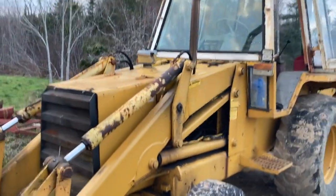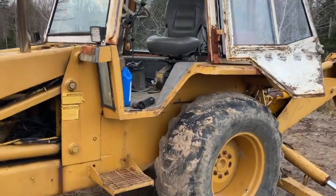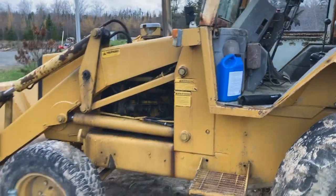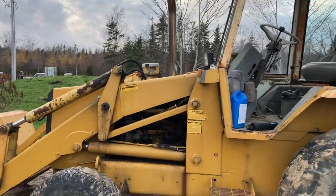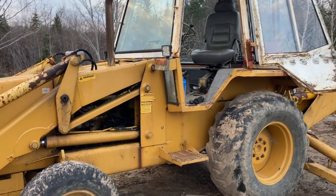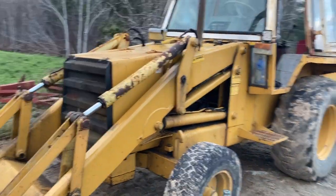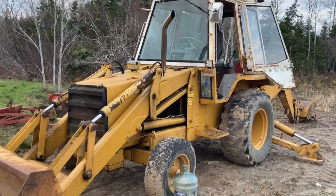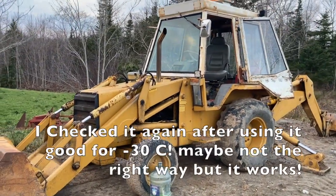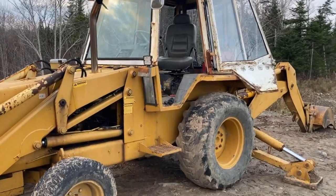I managed to get four liters of concentrated coolant in it. I sucked out about the same amount and almost got the whole four liter jug back in - just a little trickle left. I know this isn't the proper way to do it, but it's supposed to dip down cold in another couple days and I just don't have time to do it properly right now. Tomorrow I've got to fire this backhoe up and operate it for probably four or five hours - that'll get it nice and warm, get the coolant stirred up, and then we'll do another quick check on the freezing point. If that's good we'll leave it like that for the winter. Thanks for watching!